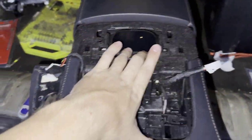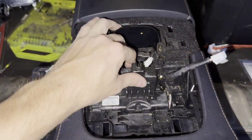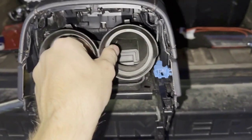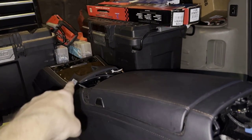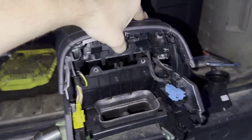After we've removed these two pieces, we're going to have three more T20 bits. Supposedly we should be able to disconnect the top piece of the console from the bottom from the rear. In the written forum post, the guy did forget to mention one thing: if you pull this out and set it to the side, there are four bolts — one, two, three, four. When you take those out, you can separate the bottom from the top, and that's what we need to get up in there. This is insane that this is what you have to do for the cup holder. It'll come apart like this — I just need to unplug those cords right there. I slid these things forward, they came out of their little holes, and the whole top piece comes out. And there is our problem right there.